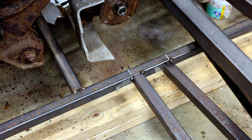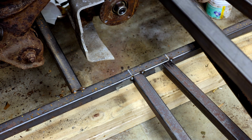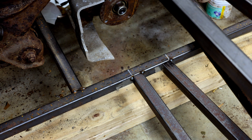See how much it moves with those bottom cross members in — it's not moving at all. That's a real-life example of how chassis design works. You stress the chassis in a certain way, you see what moves, and then if something moves apart or together you control that dimension, and that rigidity makes the chassis more rigid overall.